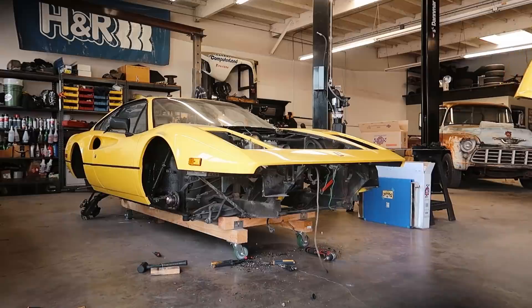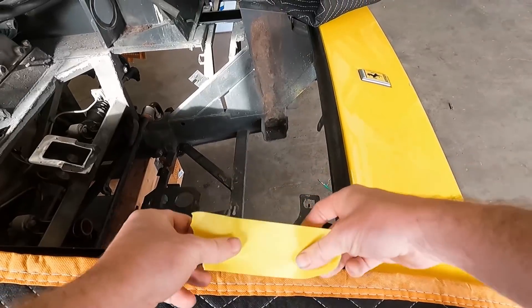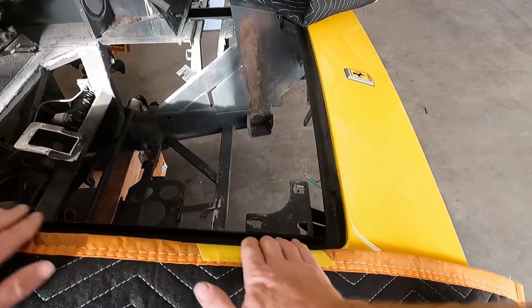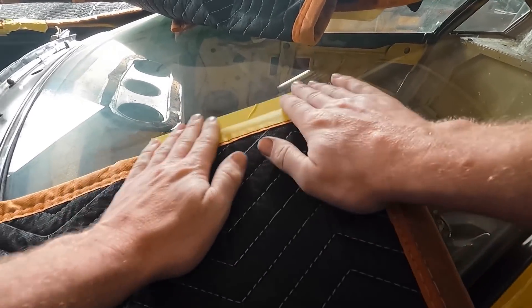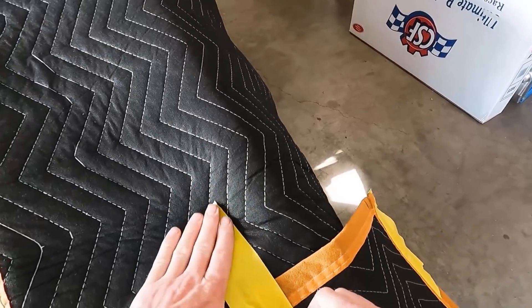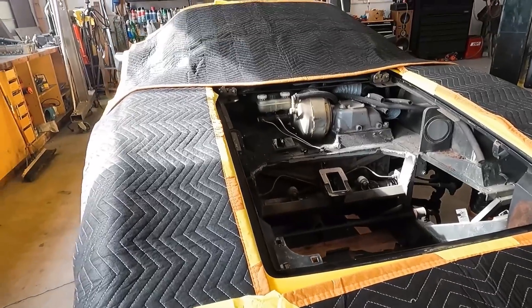With the valence off I went on and moved towards throwing some blankets over the car to cover up for sparks, as there's a lot of cutting to do today. A few of you guys may be wondering where the 3M spark paper I had used in a previous episode went. The honest answer is the paper worked really well, but it did leave behind a slight faint residue even though the adhesive is really lightweight. I found the residue kind of a pain to remove and decided it just wasn't worth the hassle, so I've gone back to the old school method of some blankets.